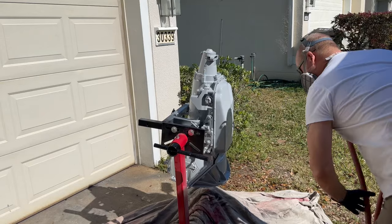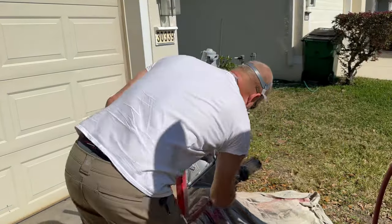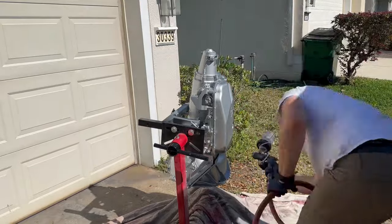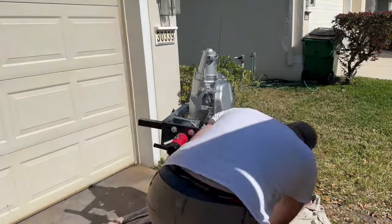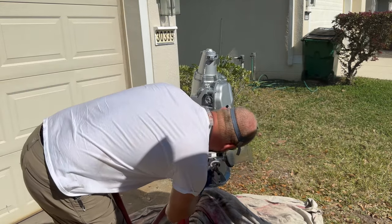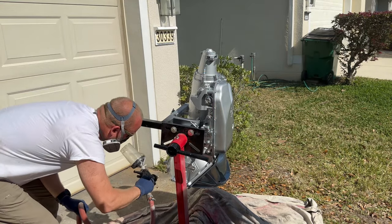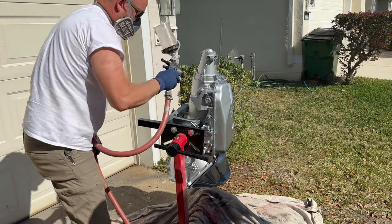Here I'm spraying the silver — you can see there's virtually no overspray. I primed it and I'm painting it and there's nothing on the garage door; you wouldn't be able to do that with a traditional system. It's a nice silver — I mixed some silvers together and to me it looks kind of like cast aluminum. Clear coating it really makes a difference. Automotive base coat and clear coat are good to about 300 to 400 degrees according to my paint people, so it'll more than last for any kind of heat — even on an engine.